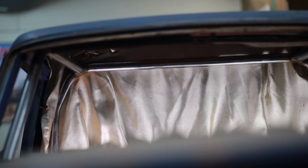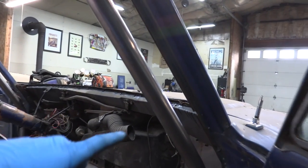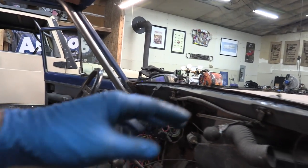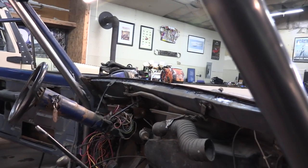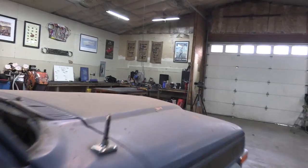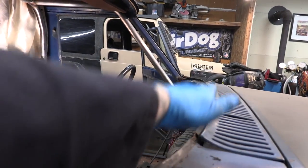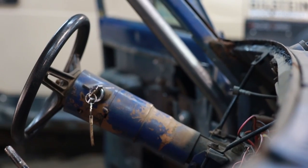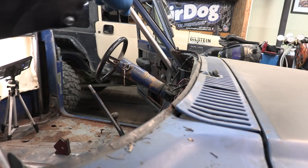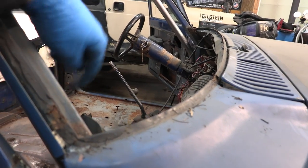I've got this halo bar all fabbed up, and now I'm ready to work on the dash section. I see three pieces of tube here - one going straight across from one side to the other, and then the next one's going to be a really complex shape. I'm not exactly sure how to accomplish it yet, but I'm going to be using a combination of a tubing bender and a tubing roller. I want a piece that follows this line, and unfortunately it's not a uniform roll - I'll need a roll here, then it straightens out a little bit, then a roll on the other side, and then I'm going to have to use the bender to bend it to contact this other piece.